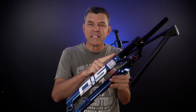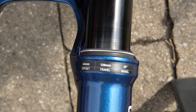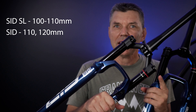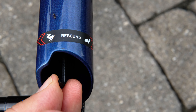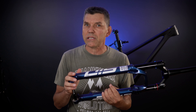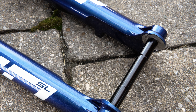Moving down on the right leg, these are 29er forks, only available in 44mm offset, but they do come in more travel options. The SL now gets a 110mm option that wasn't available before. The Sid comes in 110mm and 120mm, which was available with the 2021 version. At the bottom you'll see the same rebound adjustment, done with a tiny Allen key inserted at the bottom of the fork. And something new for RockShox — on the Sid SL only — you'll see cutouts on the lower legs, something that Fox has done with Stepcast from the get-go.